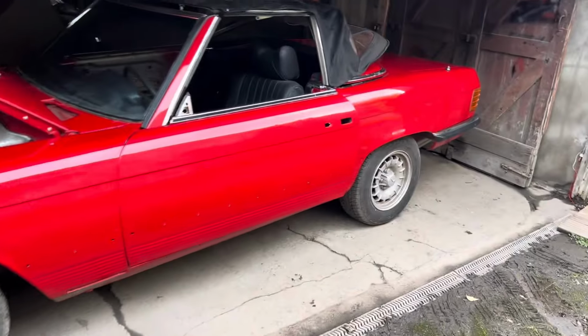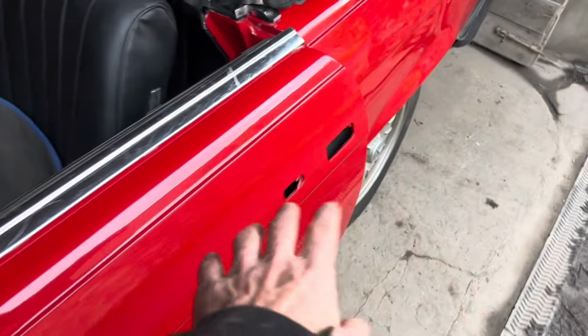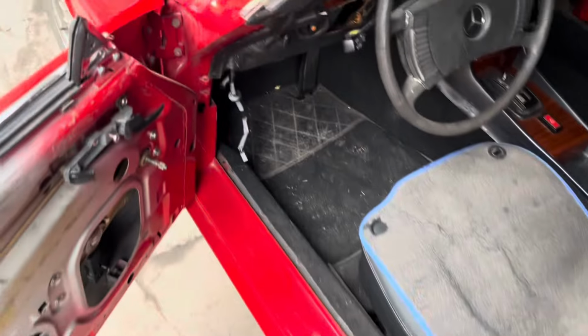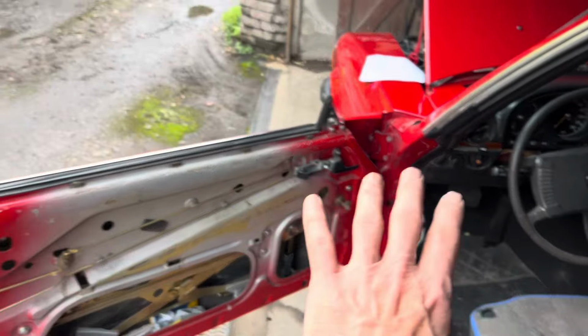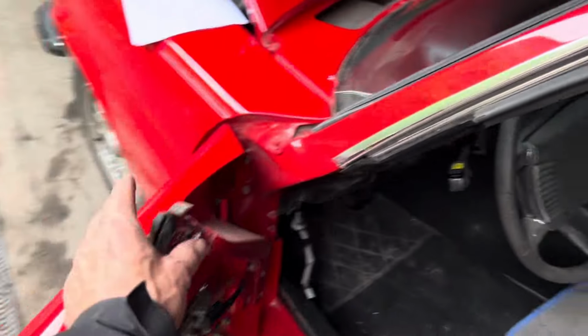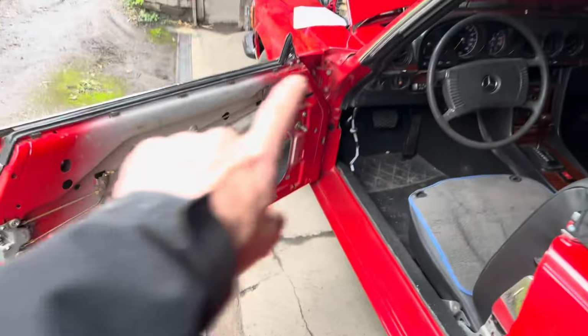The doors are going to be a big job to do. We've got to not just fit the door handles. On this side, we've got to fit a door stop in there. We've got to fit the door cards, the membrane. We've got to fit the mirrors. On this side, we've also got to fit the A-pillar chrome, glue in all the trims and the door seal.